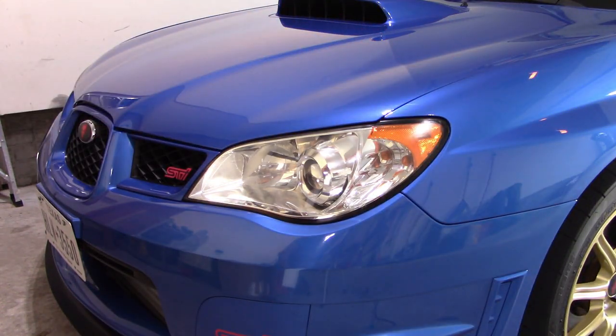In preparing to install this, I have cleaned off the headlight with a little bit of cleaner and then wiped it with alcohol — I put the alcohol in the rag instead of spraying directly on the plastic, and I used a diluted alcohol. It's been my experience that using strong alcohol directly on tail light and headlight plastics seems to increase their vulnerability or proneness to crack. I do use a little bit of alcohol to remove any residues and oils.